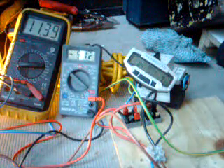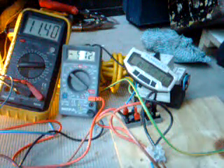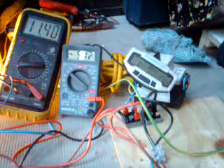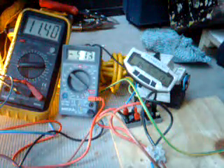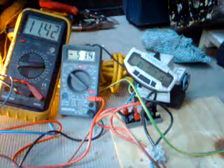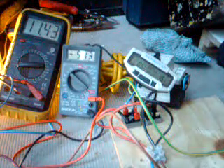We've got 11.39 volts and it's started charging - we're at about 100 revs, started putting power back into the battery over and above what it's drawing. Taking it up to 140, now up to 180, and you can see the amps have started to climb again.